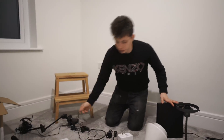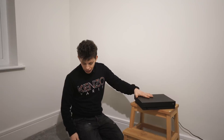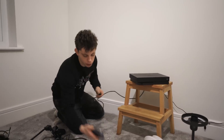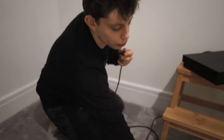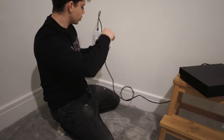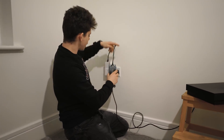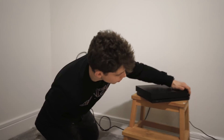If this works, I'm going to be super impressed. I apologise for the lighting — we're just in my office, which isn't even built yet, but this is our source. We're going to take an HDMI cable from the Xbox, plug it into the HDMI-over-Ethernet sender, then take an Ethernet cable into the powerline adapter. That plugs into the wall, and we also give power to the little sender unit, which is included in the box. The signal from the Xbox goes into the sender, gets converted to Ethernet, goes into the powerline, and hopefully we can pick up the signal downstairs.